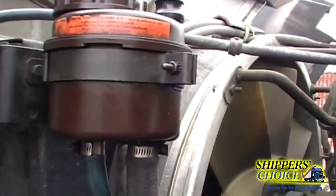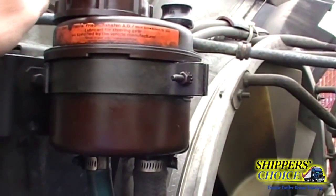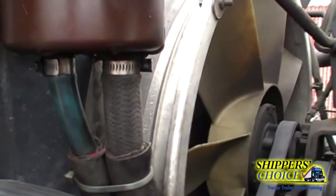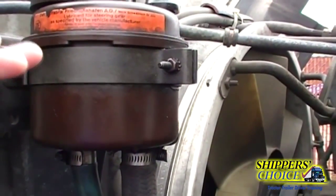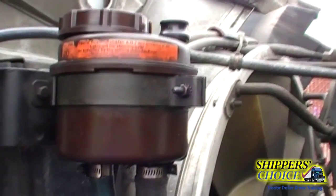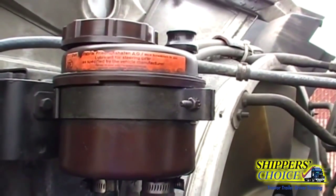We're going to jump up to our power steering reservoir — it's not cracked, bent, or broken. I'll check my level through the dipstick and refill here if it's low. All bolts are present. The rubber hoses are not cracked, dry rotted, or broken — fittings are tight and I don't see any leaks. When talking about reservoirs, it's important to mention that it's filled to the proper level, where you'll fill it if low, and that you check the level daily.